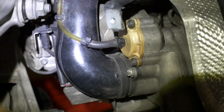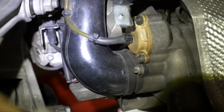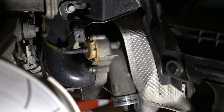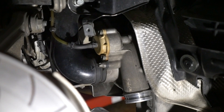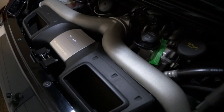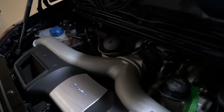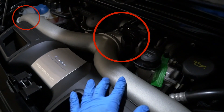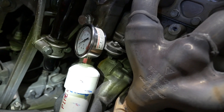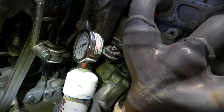Now I'm doing another boost test to see if I can build up pressure and check for any remaining leaks. I have it up to about 20 psi — so far so good, I don't hear it leaking out of the VRV area like it did earlier, so now that's sealed. Listening for other leaks on top — nothing coming out of the white pipe, which is another common area. It looks like it's holding pressure. I do hear a little bit but I think that's not a big deal.